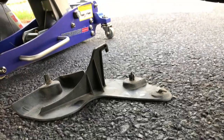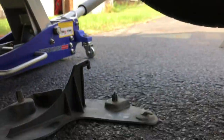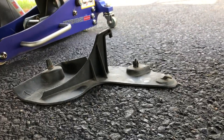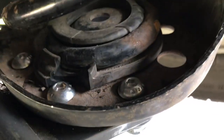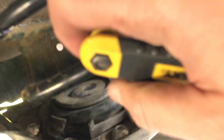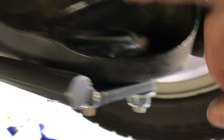This wind deflector — I took these off, it's the only way you can get the bar up in place. I will be trimming that after I get both sides on and tightened up, then put these back on. One thing I figured out that you're going to need while tightening these down is a 7/32" Allen wrench. You're going to need that to get down in there on the head of the screw. It's a little tricky — if you've got a socket wrench it's going to probably be easier, at least for this front one.